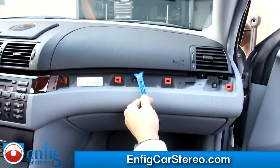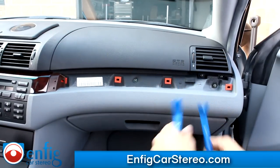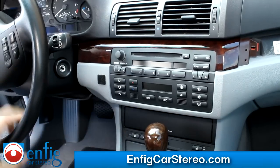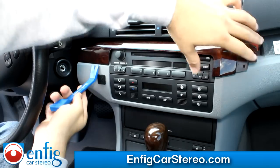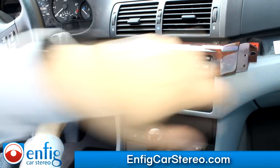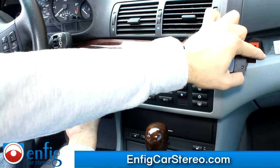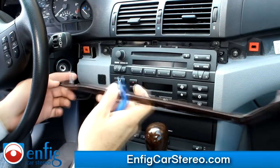This is PPT 5, the wide one — our kit includes two of them. Now let me show you how to take out the panel over the radio. This piece is held in with one clip over here and one more over here. Use the wide panel tool, not the little one. Go right over here and pry straight out — if you pry straight out, it comes right out. It's when you disturb it that you have issues.